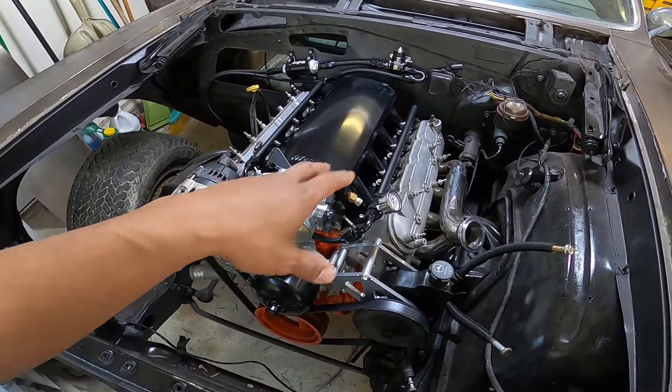Coming up, we're going to swap that transmission out for a 4L80E — I don't think I'll run the 4L60E at all since this is a twin-turbo build. We'll put in a monster transmission in the future. The next video coming soon is going to be fitting a radiator — that's the very next thing we're really going to do on this car, and we'll probably have to cut up the radiator supports to get it in.